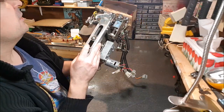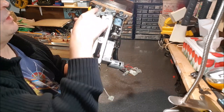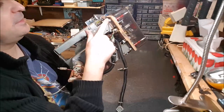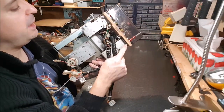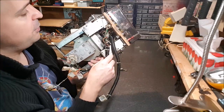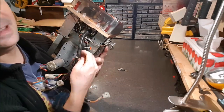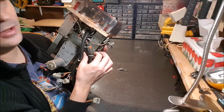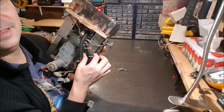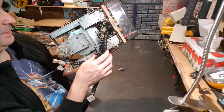There are a lot of screws that are not original either. This one is supposed to be a Phillips screw, and these others are a flat type — not original. This coil assembly is also just about to fall apart. It was maybe a dozen games away from falling apart completely.